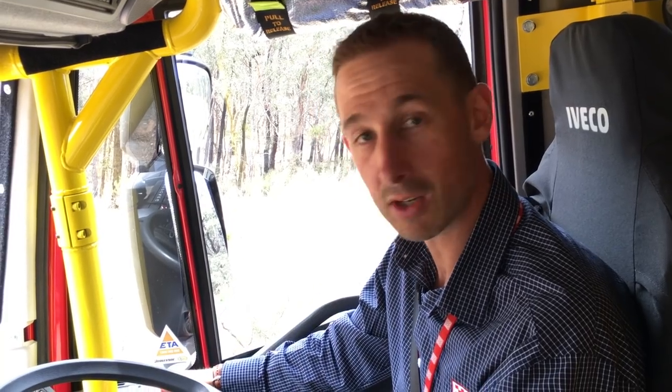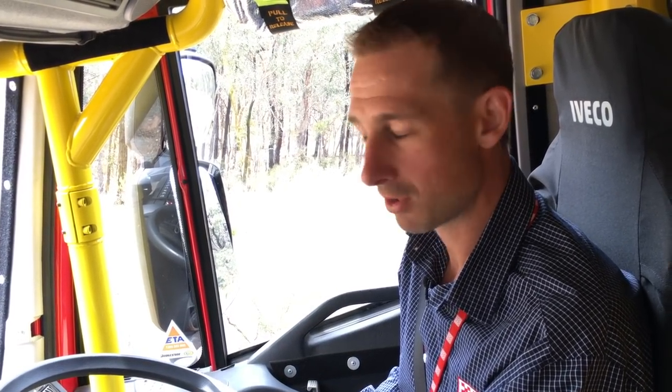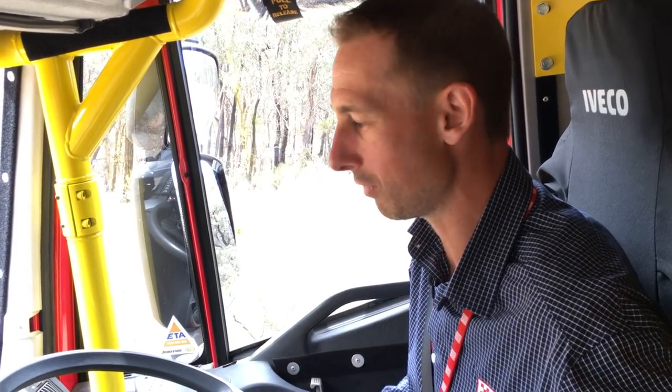Driving tip three: when going down a tricky descent I've now brought the vehicle to rest to get over a small obstacle. At the same time the clutch is now disengaged. To continue my movement I need to ensure that I've got full control of the vehicle. I have my exhaust brake on the second setting as always when driving off-road. Like we learned on the park brake start, I build up my rpm to about 700, feel the clutch start to bite and re-engage, and take off again.